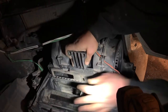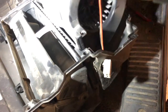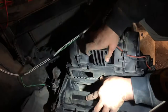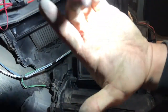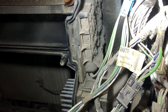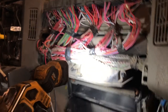There's foam on the face of the blower motor, and you have to remember to take this little wire bushing out right here — I was able to get it out one-handed with my thumb. Because of the foam it's kind of a two-handed thing; you have to wiggle it back and forth to get it out. There were actually some solids in this one. You can see the air filter for the blower motor is completely packed.